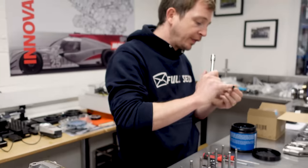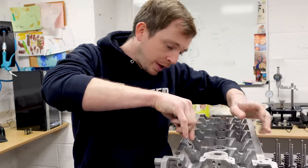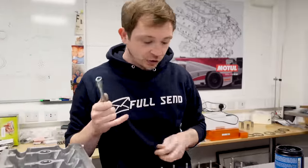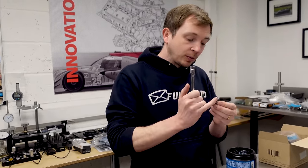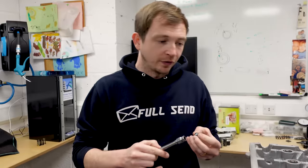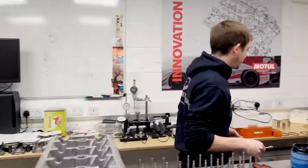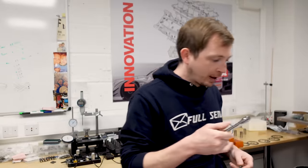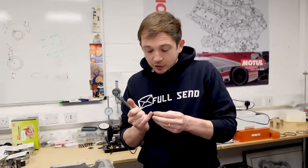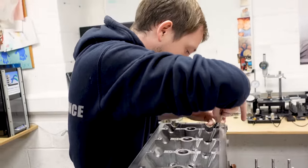I don't lay everything out to make it look pretty - that's a byproduct. I lay everything out so I've got full visibility over the parts I've got. Everything's clean, I know I've got the right quantities. If everything was just in a big bucket from the parts washer, when you come to assemble and you've got one missing, is it still in the bottom of the parts washer? When you strip these heads, those spring seats are a nightmare to get out because they've got oil under them - if you put the head in a hot wash they can all fall out into the tank.